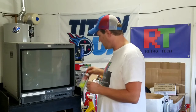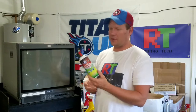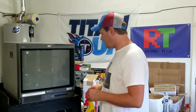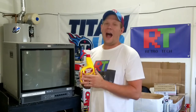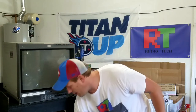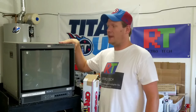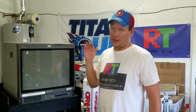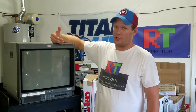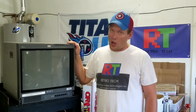You're also going to want plenty of compressed air. I use an air compressor, but if you don't have one you can buy cans of compressed air. Now let's talk about cleaners to avoid: I highly recommend not using Goof Off on your PVM or really any electronic with metal or plastic, because it tends to eat away at the outer layer, discolors everything, and can even start eating away at the plastic. There's something that chemically happens with Goof Off and plastics that's almost irreversible. So don't use Goof Off. You can use Goo Gone if you need to remove tough residue — I always say try alcohol first, but Goo Gone is safe.